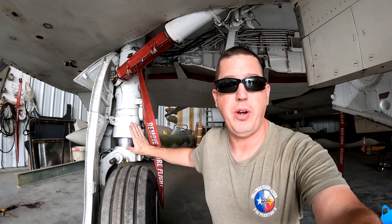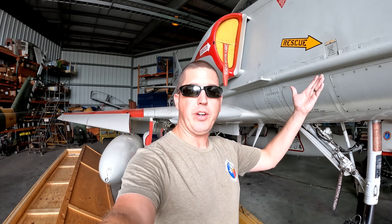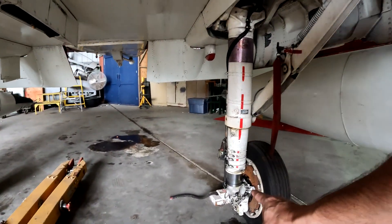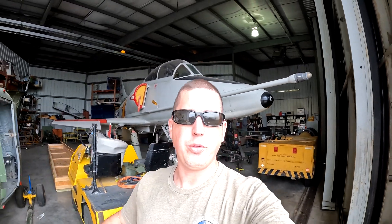I do apologize — this one's going to be a little shorter than normal today. Right after I fired off the high pack air cart, things just started happening pretty quick around here. We did have to put some air pressure in the lower strut on the right main — over time it leaked down and just settled. So we got some air pressure in the right-hand strut again, then rolled over the nitrogen cart and aired up all the tires. She is ready to roll for the air show. While we were at it, we also came over to our A4 and topped off the tires, and one of her struts had also leaked down over time, so we had to inflate the left main on that one. But now she's looking real good and she's ready to roll as well.